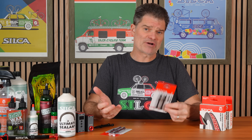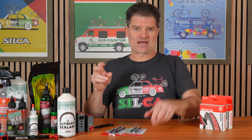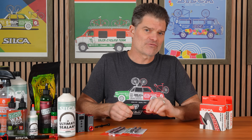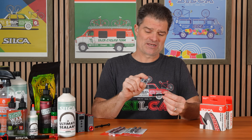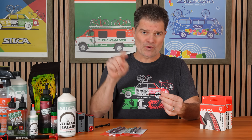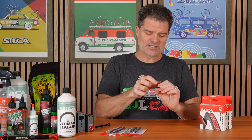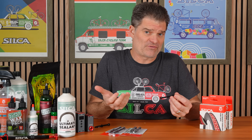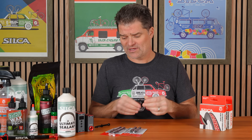How did we do it different and better? Well, I started by buying every single valve on the market, including all of the fancy high-flow valves that people love. The thing that really shocked and surprised me the most: high-flow valves are higher flow than a Presta valve with the core in it, but none of them are as high a flow as a Presta valve with the core removed — because all of them were limited by this diameter down here. Every one of those valves necks down to just the opening equivalent of a Presta valve, and with the various core spindly things in there, you're occluding the flow, reducing the cross-sectional area to slightly below what you get with the core removed.